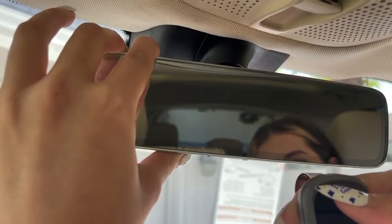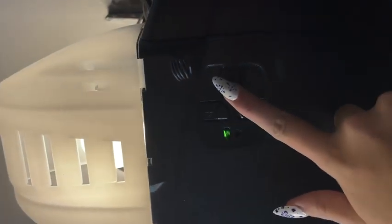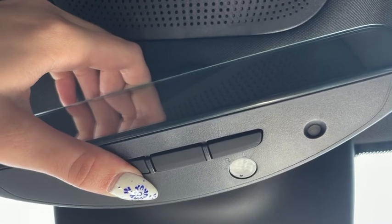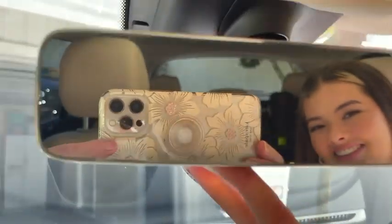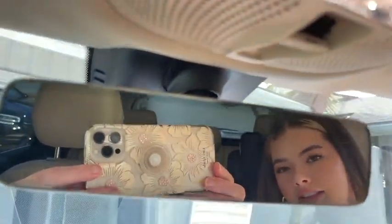As soon as it blinks green, you're going to go into your garage and press the sync program button. This may look different depending on your model. We now have 30 seconds to get back into the car to hold down the initial paired button for 2 seconds multiple times for the car to connect to the garage door signal.